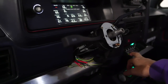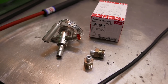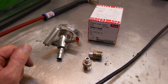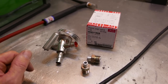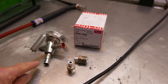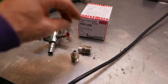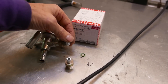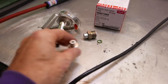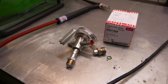I'm upgrading to a larger thermal expansion valve — it's a 2.1 kilowatt versus the one kilowatt I've currently got, because I'm pretty sure the expansion valve is undersized relative to the compressor. The new one has 3/8 inch in and 1/2 inch out versus the old quarter inch in and 3/8 out. The number 8 male insert O-ring will just fit — I can epoxy it in, it'll fill the gap, then plunk it in the car and try it.